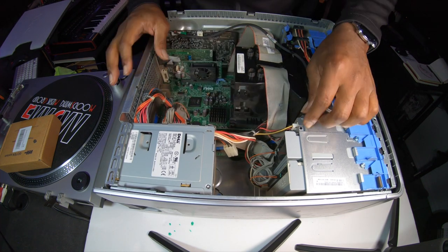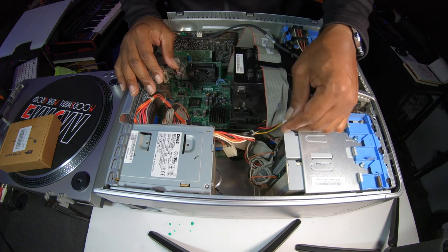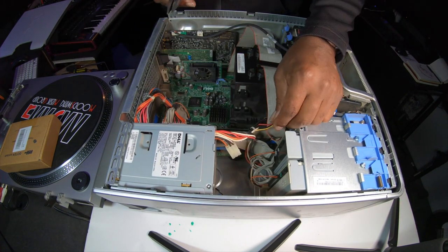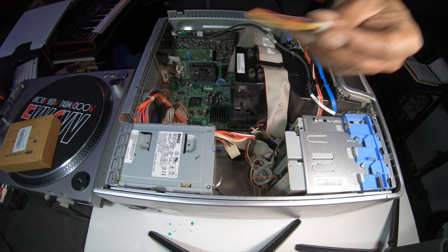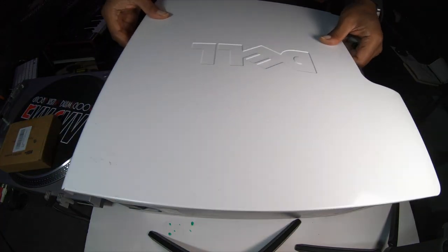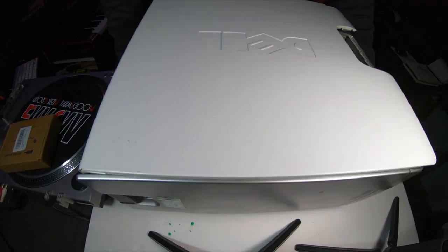Years ago when I redid my MPC and put the zip drive in, I had to rewire it because the zip drive has a four-pin power connector on it. So I had to take the floppy drive connector out. I took this old Dell computer I got and stole the connector off the floppy drive so that it'll work on the new GoTek.